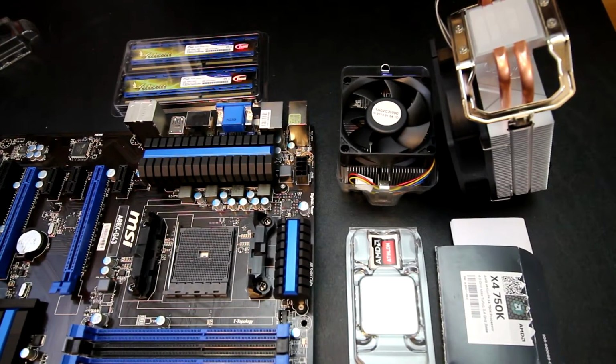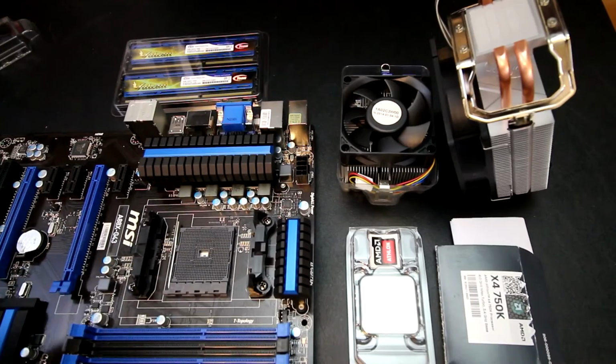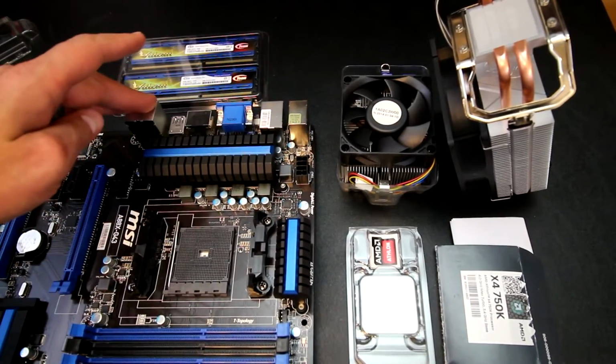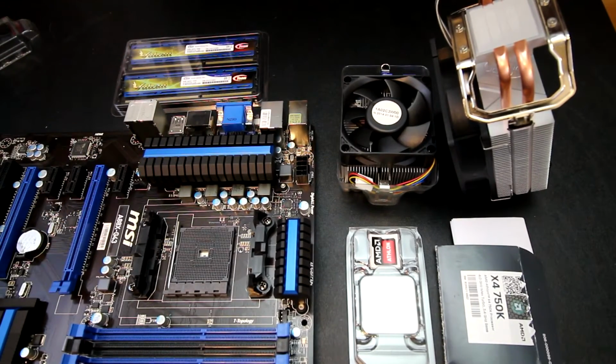So when I prep the motherboard, I take it out of the bag and I just give it a real good look overall. I make sure everything is together, not broken. There's no bent pins on the fan headers or broken heat sinks. The rear I/O is fine. There's no missing pieces or anything broken off, stuff like that. The battery is in place, just some different things like that, fan headers, all that. So I just make sure that physically the board is okay, no capacitors missing, or something that would just pop right out in my mind and be like, oh, that's wrong.